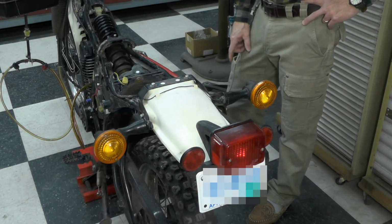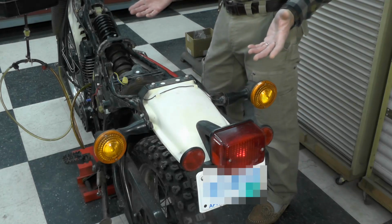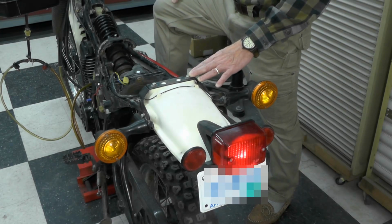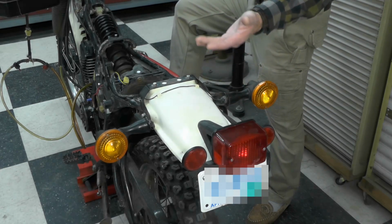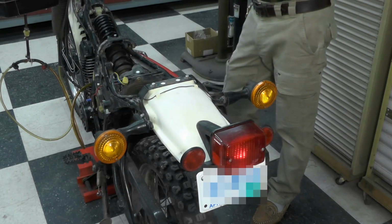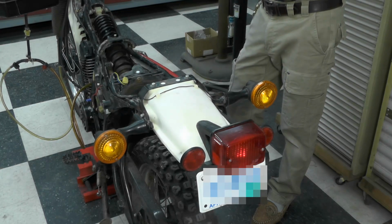And I continued to do the testing of the wiring with my multimeter, and everything seemed good all the way up into the headlight shell, which is where the front brake switch goes into the headlight shell and ties into the master loom. So let's relocate up here at the front brake light connection where the wiring plugs in, and we'll talk about that a little bit further.